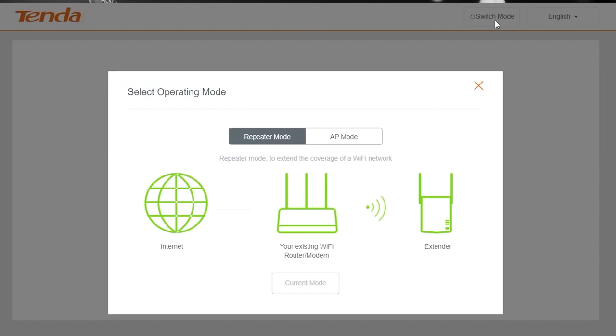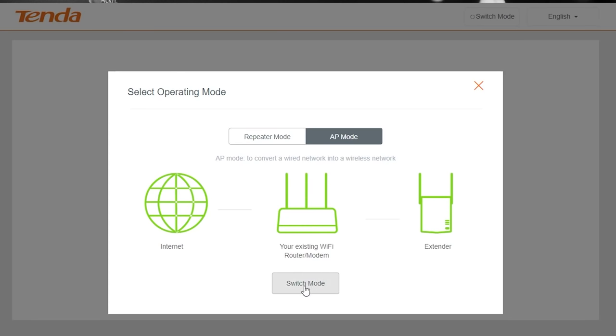If I click on that, it asks: do you want this to be a repeater — a Wi-Fi extender — or do you want to turn it into AP mode? AP means access point, and that's what I want to do. Now before I click, notice this part here has got the Wi-Fi symbol, meaning the connection between the extender and your router or modem is over a wireless network. If we click on AP mode, we can see that now changes to a straight line — a cable. So it's now saying: in this mode, you need a cable that runs from your extender to your router or modem. That's what we want, so we'll confirm that.